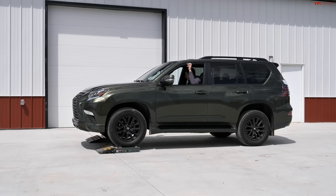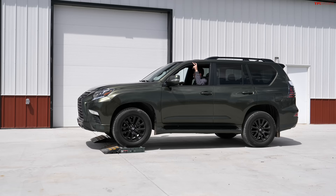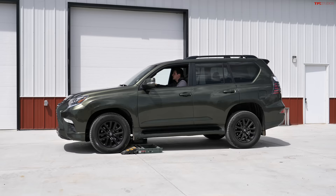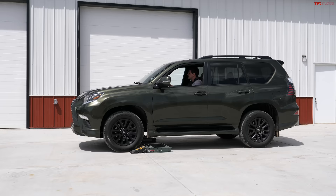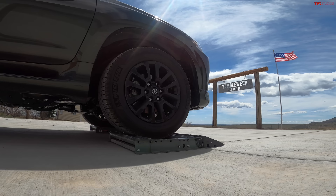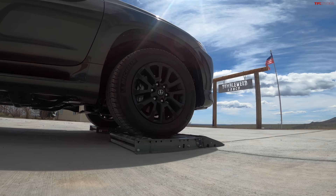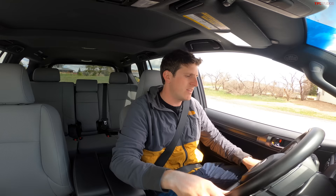Lexus uses that traction control system, and also a differential lock. So in this front wheel slip test, both front wheels are completely stuck in the roller and the rear wheel is on the ground. With the center diff open and unlocked, in normal four-wheel drive high, the traction control does engage, but the front wheels actually spin a little before we get unstuck — which is not what you'd expect in a typical truck with four-high engaged, where the front and rear drive shafts are locked together.